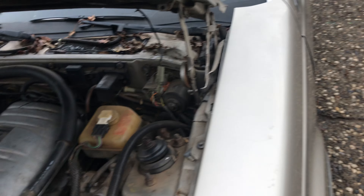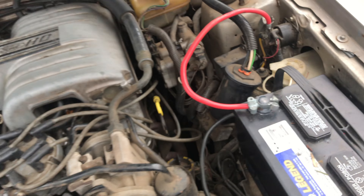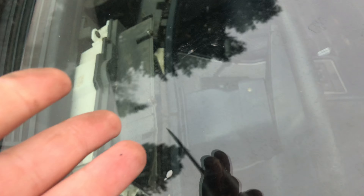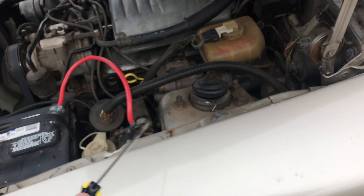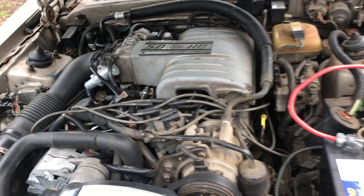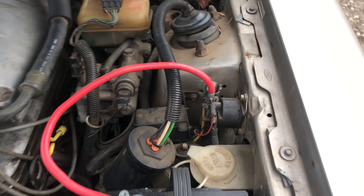Again, just find your starter solenoid — it's right there. This is a starter relay because it's a Ford. You can't do this the same way on a GM because it's down there. On a GM car you'd have to rip the thing out to get to it, because GM just ran a straight line down to your starter. Ford decided to just mount it right here so you could test it super easy — way better.